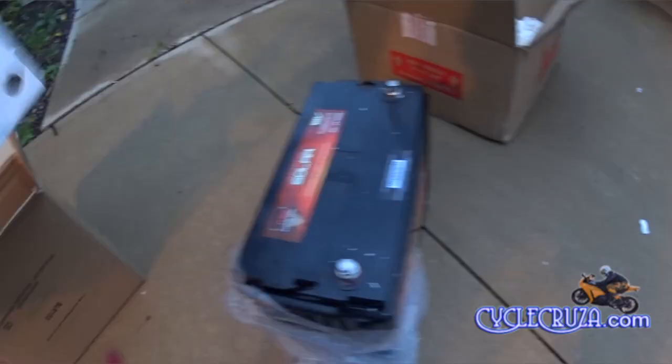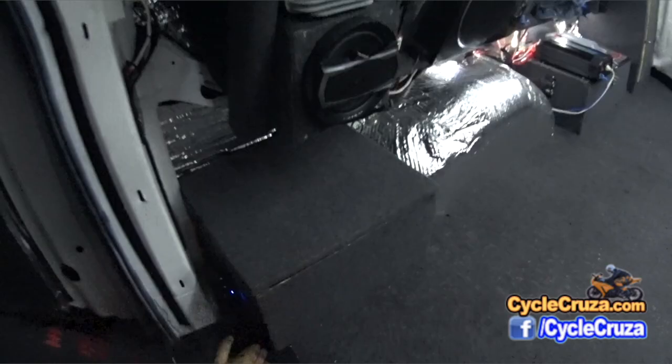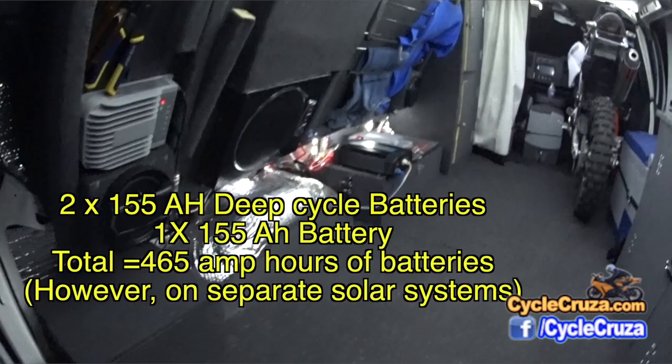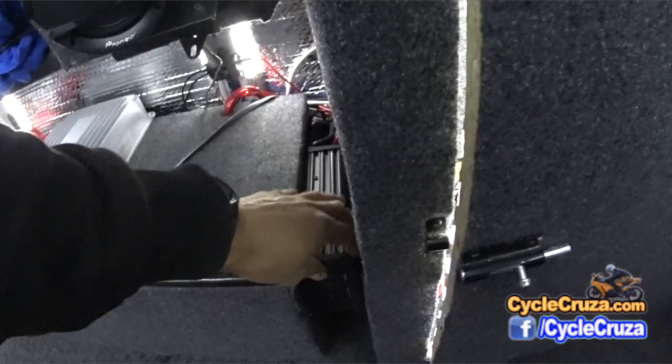This is actually controlling a 155-amp hour battery, which fits like an absolute glove here. I have two batteries in that battery box — two 155-amp hour deep cycle batteries, safe for indoor use. They do not exhaust toxic fumes. I also have the 40-amp MPPT solar controller here, which I did upgrade to. Here is the battery charger on the side — if I have any problems with solar, I can charge these batteries via any AC plug.